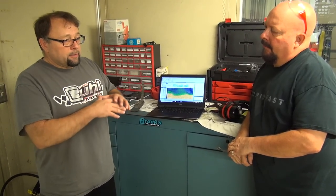And what we were able to do is actually go into the ECU and find Kawasaki's noise control software, where they switch maps, they switch throttle maps, they switch exhaust servo maps, they switch ignition maps, and all sorts of stuff like that. And we can actually go in and shut that entire system down. That's one of the things that's really unique with our mapping, that we actually disable that whole portion of it, so we get much more consistent. We don't have the map switching and things like that. So the maps that we're editing are the maps that the bike is actually using, and we're forcing it that way all the time. So that's why we get such consistent results with our flashing.